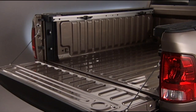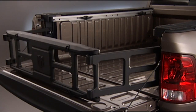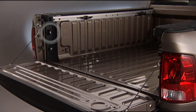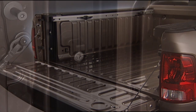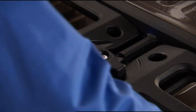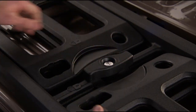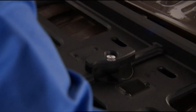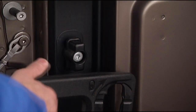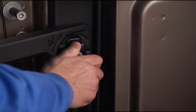On 1500 Classic models, the extender position lets you extend the bed out onto the tailgate, giving you 15 inches or 38 centimeters more cargo space when needed. Find the locating pin and rotating handle on both sides of the truck bed near the tailgate. Lower the tailgate and turn the center handle vertical to release the side gates, then slot each side of the gate onto the pin and handle, and turn the handle to lock it into place.